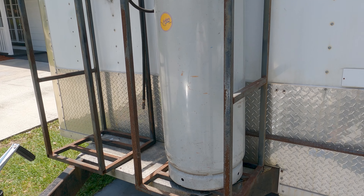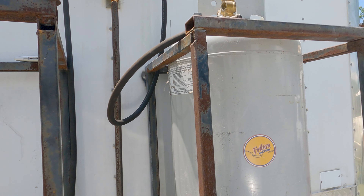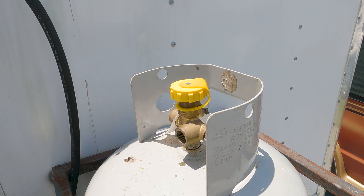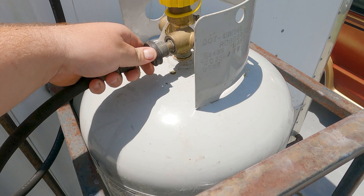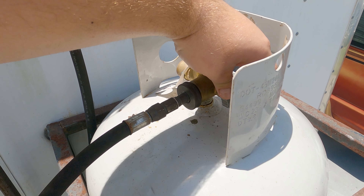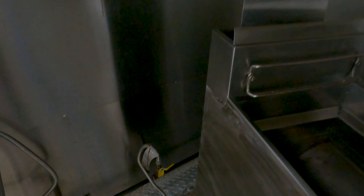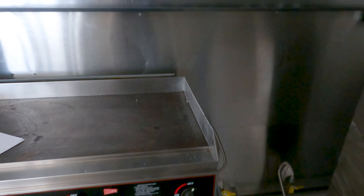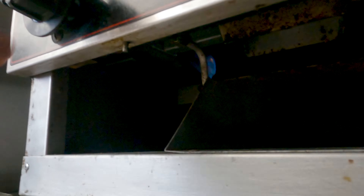This tank is almost empty and it was really a challenge to get it up there, so I don't even want to know how it's going to be with a full one. I hooked it up to test it off camera, and this O-ring was bad so I replaced it with a new one because it was leaking. I had a quick walk around, made sure everything was switched off apart from the griddle, and sniffed for gas for the past 15 minutes — everything seems fine. We've got pilot lights on, so let's see.